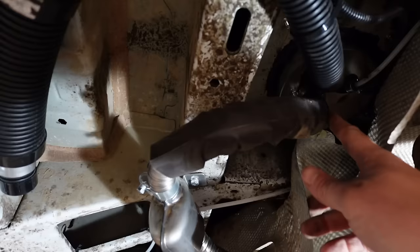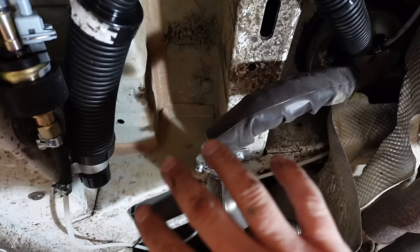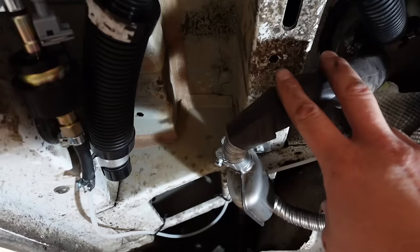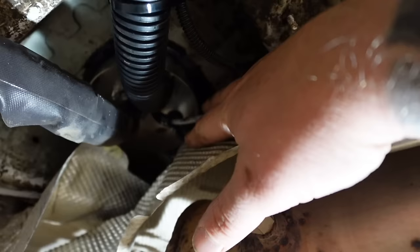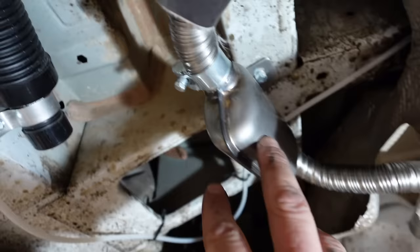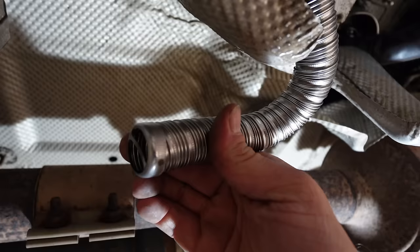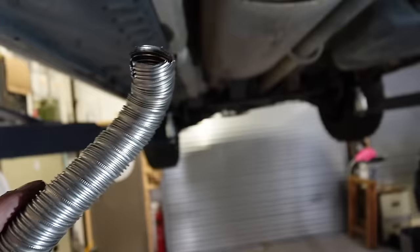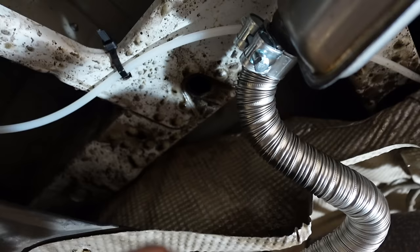Here is the exhaust line, which comes with a padded heat shield to help with routing. It should not be near any plastic - we needed to trim a tiny bit of the under tray. It can touch the metal heat shield but do not let it touch anything plastic or rubber, and definitely don't put it near your diesel line - that is the worst scenario. The inline muffler is not directional; it doesn't matter which way round you orientate it. It has a jubilee-style clip either side and a grill on the end.